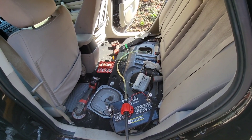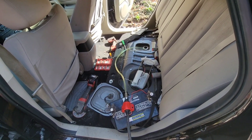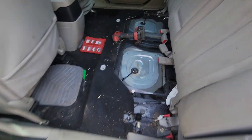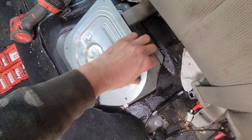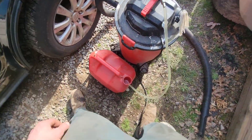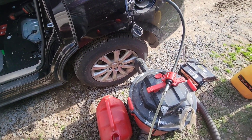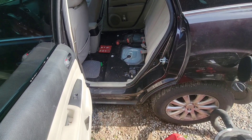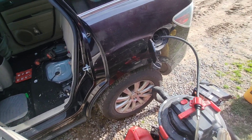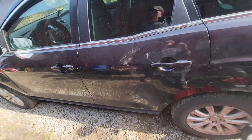Once this is done pumping, I'll run and get some gas and put gas in the tank, then I'll go from there. So I got that side all put back together now. Made my connections, hooked it all back up, put all my screws back in. I'm going to pump five gallons in here. I just got the Edelbrock electric fuel pump — it's hooked up to a spare battery and just pumping some gas into it. I was going to pour it down the hole in there, but I didn't want to get fumes in the car, so just do it like this.